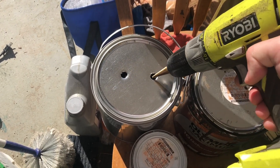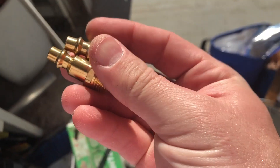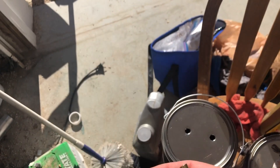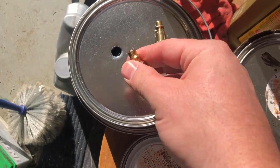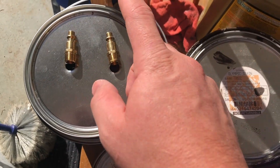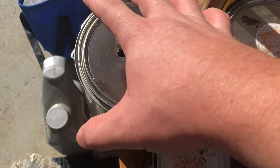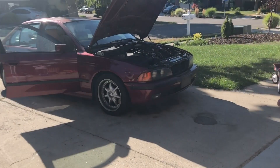I just got a simple step-down drill bit here. Got some holes in the top of the paint can — two compressor nipples from Harbor Freight. We'll screw those in there, then the tubing will go on one, and the compressor will hook up to the other one to provide positive pressure. Then we light some smoke bombs, put them in here, let this thing fill with smoke as we've got positive pressure coming in, pushing the smoke into the intake.